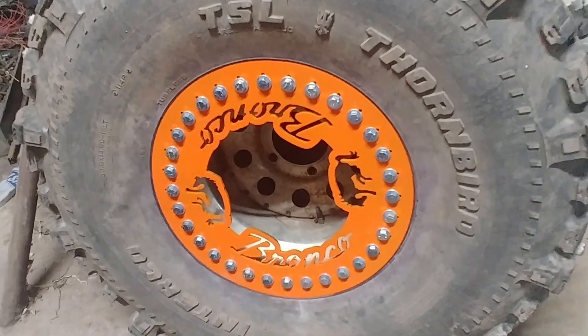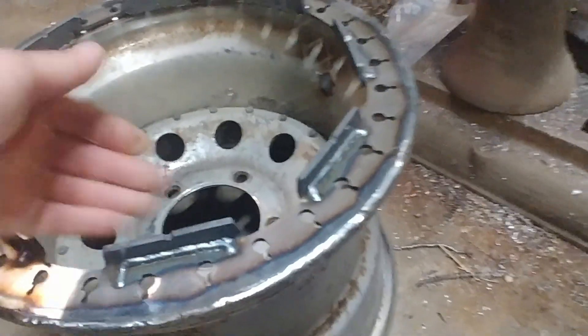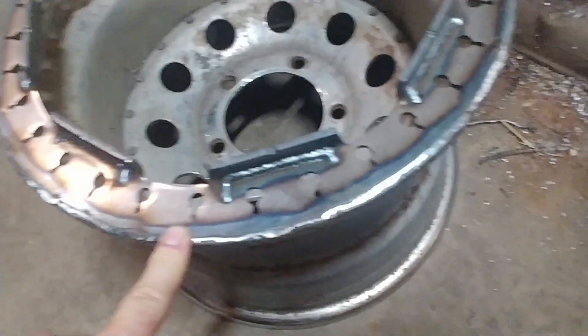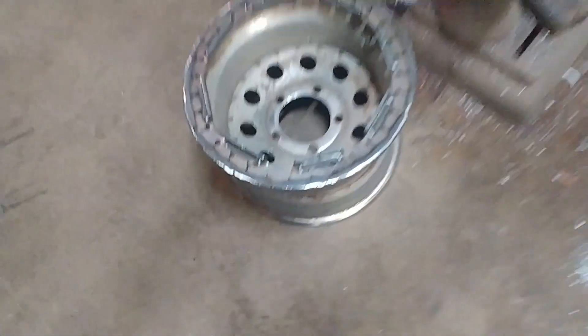They have an anti-coning inner ring. These tabs here were flat when you weld them on, and then you take a crescent wrench, bend them up 90 degrees, and weld them. They call these drainage holes — sure they'd drain if you're wheeling in water. Here in the Midwest, that's not going to drain the kind of mud we play in. But it's a nice feature, couldn't hurt.